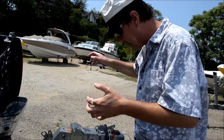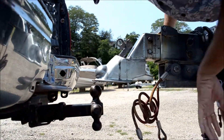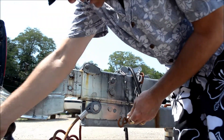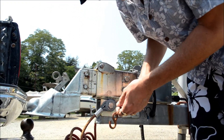Safety, safety, safety. You put these safety chains underneath and hook them up to the truck. If the trailer pops off, they catch it like a basket so nothing bad happens. This breakaway cable hooks up to the truck too — if something bad happens and the trailer pops off, it activates the brakes.